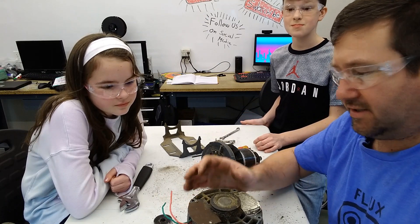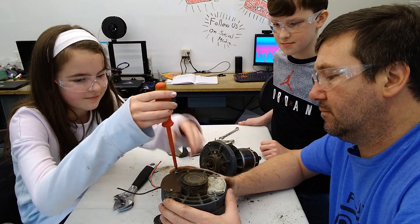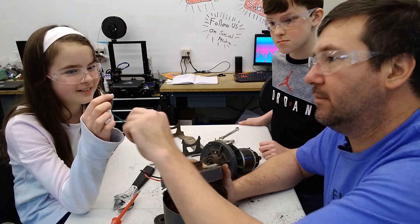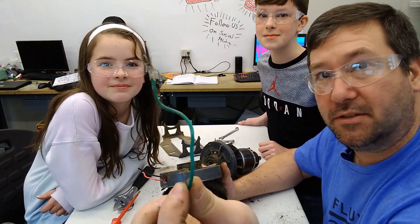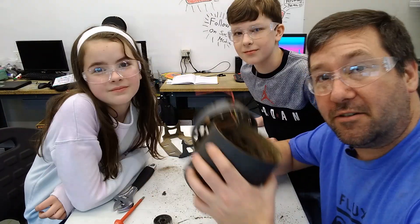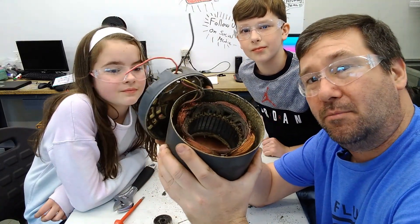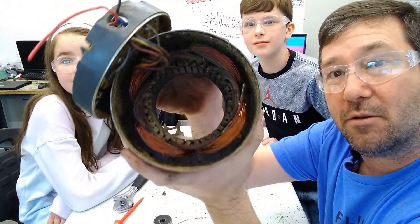Okay, and there does look like there's something back here. Anyone want to take that cover off for me, Wendell? One just fell out. There's a ground wire that was just kind of pulled up into the motor casing. So there is no capacitor in this motor — so this must be one of the shaded pole motors. Just so you can see what everybody wanted to know, there is the inside of the motor.